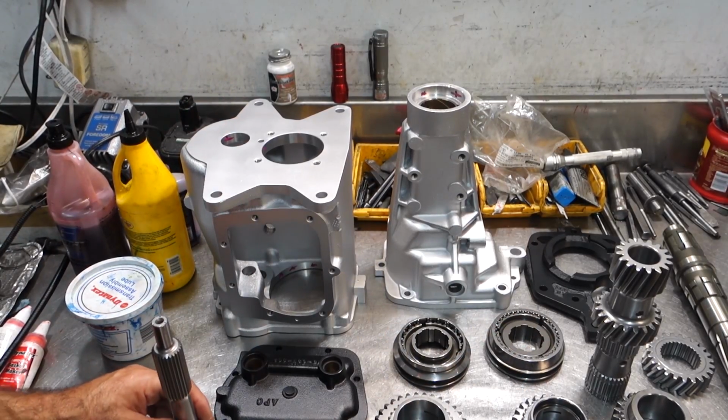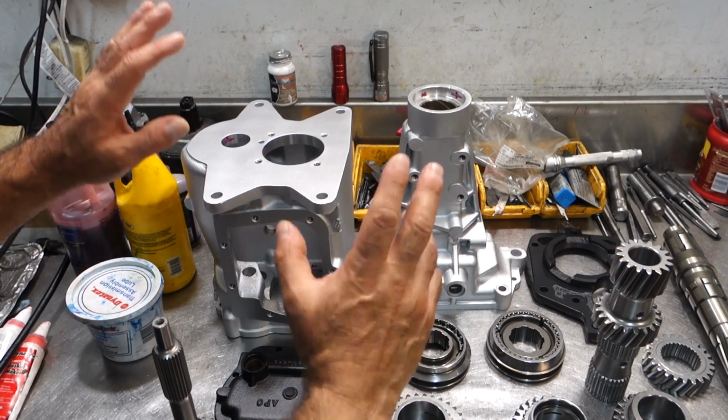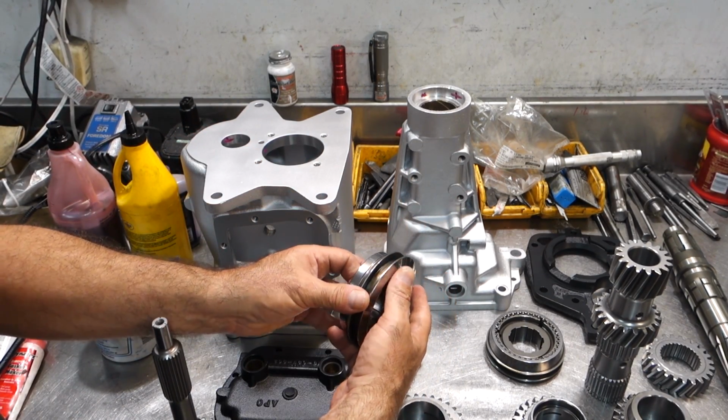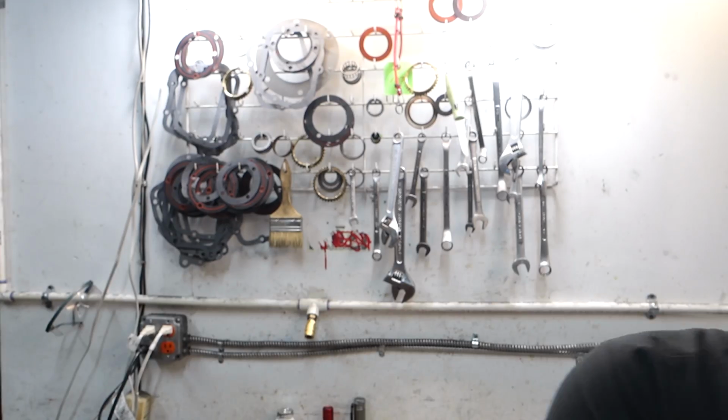Okay, so I'm going to build one of my Spec 25 transmissions, and I've got the shop peened and polished gears, the Teflon coated case, the super finished synchronizer assemblies. Nice, huh? This transmission is going to go into a 1969 Trans Am road race Camaro.